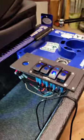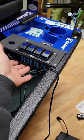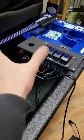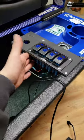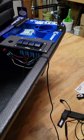All these lights are from Ice Hole Power — there's a packet of 10 that I bought. Worked out super nice: just drill a hole, run your wires through, and they make it super easy. All you had to do was run your positive to the switch for all the lights, then connect all your negatives together. Your negative comes from your master into your switch panel, and then it runs all the way through.